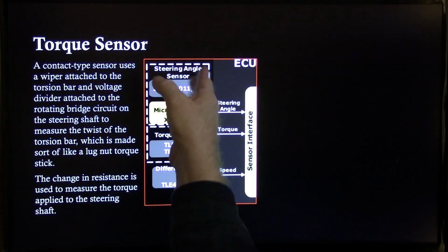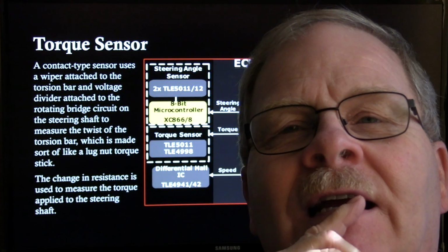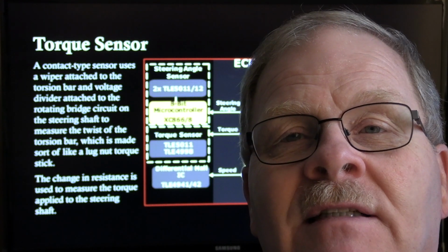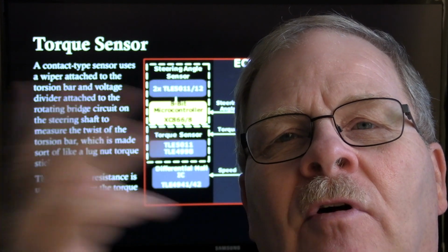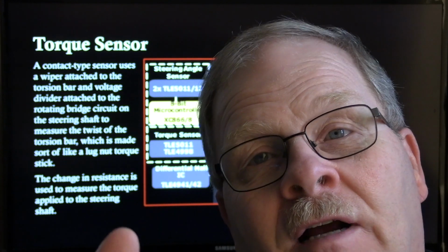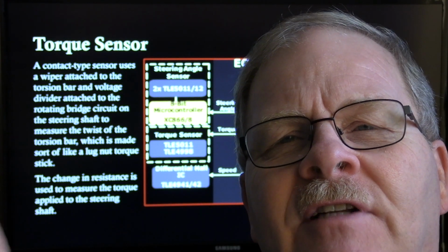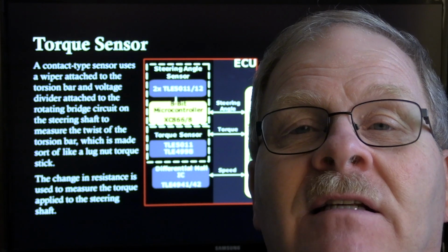And steering angle sensor. All of this stuff is factored in, and the algorithms in the computer will take care of that. Whenever you're putting one on a Toyota, it'll throw you a code if the steering assist map hasn't been written. And there's only like 3 steering assist maps, and I think it has to do with what part of the world you're in, depending on whether you're used to driving on the left side of the road where the crown's in the middle, and that kind of thing. If you go rooting around looking for information on exactly what a steering assist map is, Toyota's the only people that talk about a steering assist map.